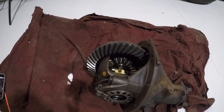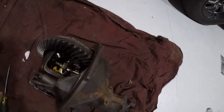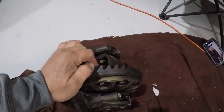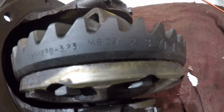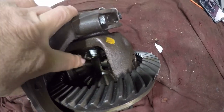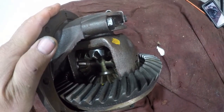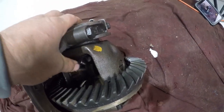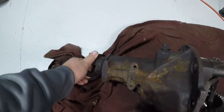Most of the time you can find the gear ratio on the ring gear itself. I can show it to you here. As you can see, it's written on the ring gear on this particular ring gear — 3.23s. That's a 3.23 to one gear ratio and it is an open differential. So you have to turn the tire two turns and count the drive shaft and how many times it turns to figure the gear ratio out on this one.